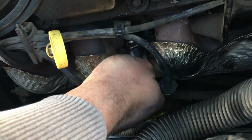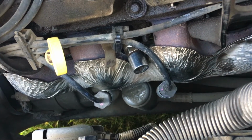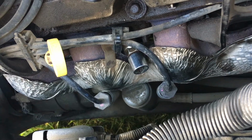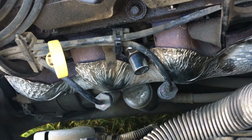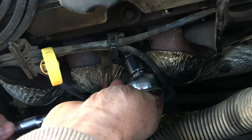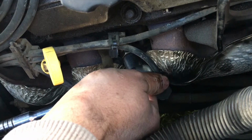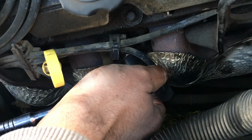Like I say, I almost seated this one. Then I'm going to take my ratchet and make sure it's going the right way. That's what I like about ratchets, I can check it out here and be like, yep, I'm turning it the right way. I come in along the front, snap it in there, and then we're going to torque these to 20 foot-pounds because they're new.